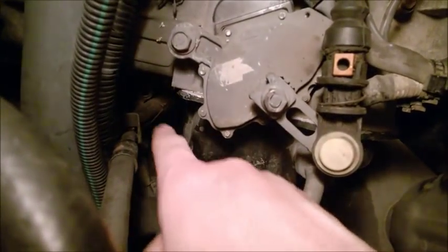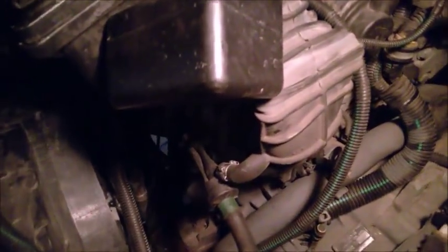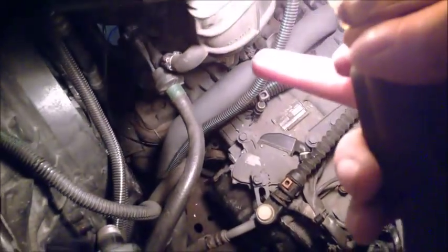The idea, if you look at how it looks, is really I'm just clearing the whole side here. I'm clearing the whole side of the cover. So that's where it goes. You notice I did toss the whole air intake, air filter unit on the side. I didn't disconnect it on this non-turbo, but maybe you will need to disconnect it on the turbo. The turbo may have another hose here, I'm not aware of it, so check it out. On this one I did not detach the radiator hose, so I'm not draining the coolant. There's just enough space. You notice on the side of the cover, there's plenty of space.